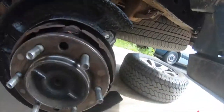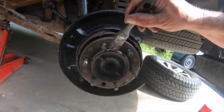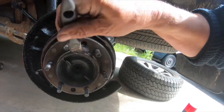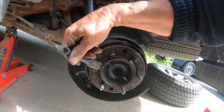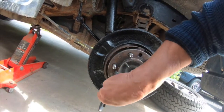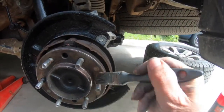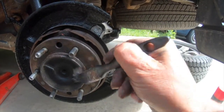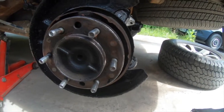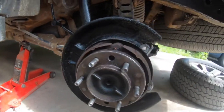And we just want a slight bit of copper grease. And a little bit around these edges in there, just to stop your disc from rusting on. They get, well, they're really difficult to get back off. There's a little bit of copper grease around that. Don't need a lot. If you're not careful, you end up with it all over the place. So that'll do for that.